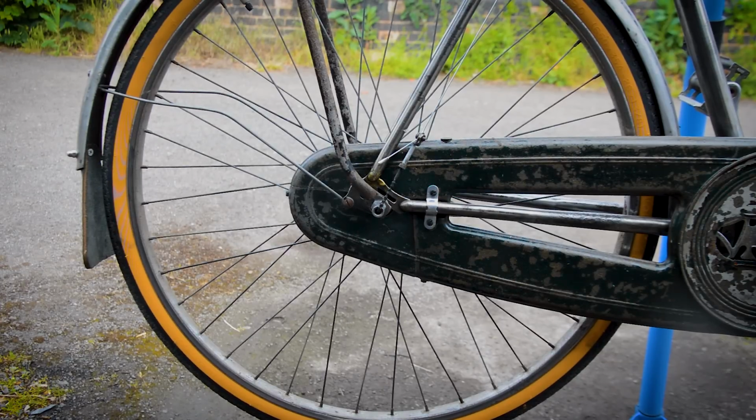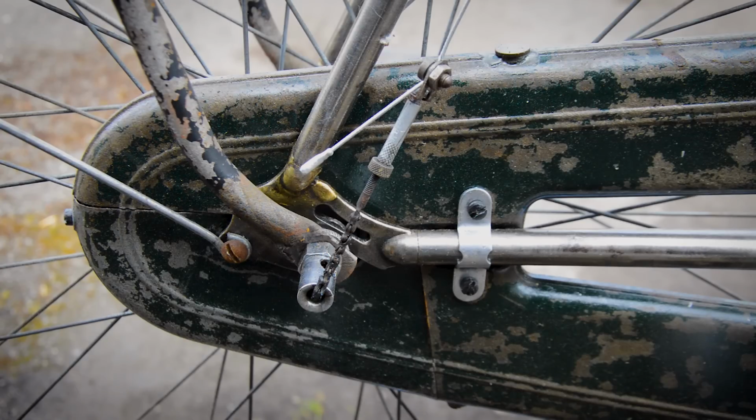So it's back in the garage time. Changing this out isn't going to be too difficult. The main thing on this one, of course, is the chain case, but that should just be a case of 1-2 screws to get it out, and then that bottom cover will come off, allowing me to access the wheel nuts and then drop the wheel out. But there is one thing that you want to just make sure you get in the right position before you take this off. We're going to be having to remove the rear wheel.